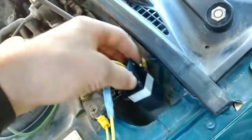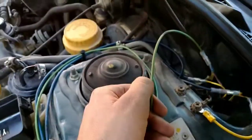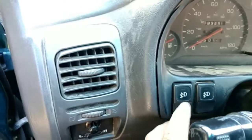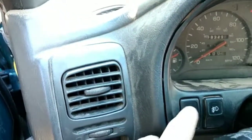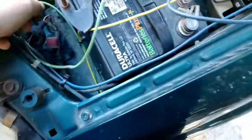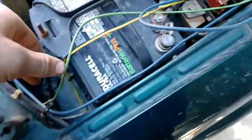This is just a jelly-bean part — a Hella lighting relay, I think it's like a fuel pump relay from an old Ford. I have this green wire which is my solenoid control; this runs my switch, which is just another same-year fog lamp switch. The security system indicator light goes there, so I just replaced that. My wires run up under the dash — I did a quick and dirty install, stuck them through my fender, and have my power running to the relay coming out through the same fusible link.